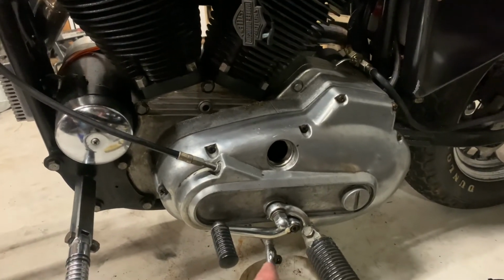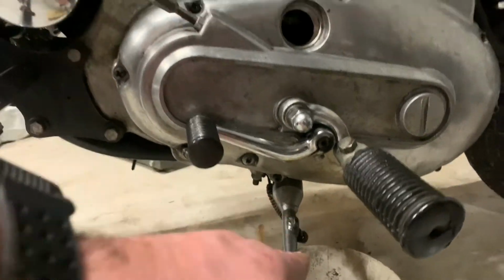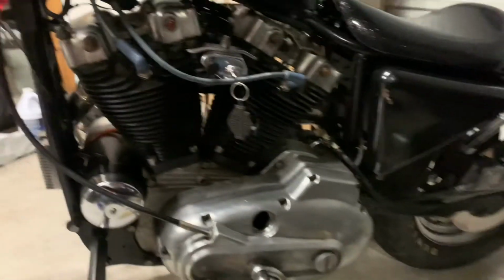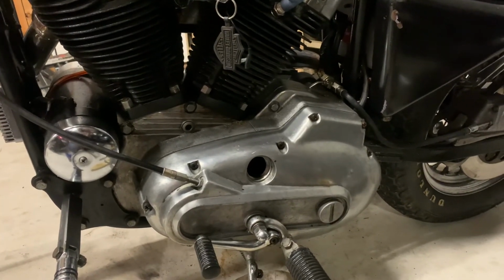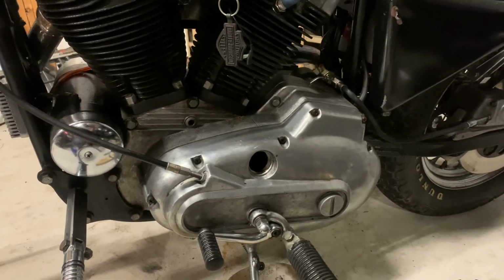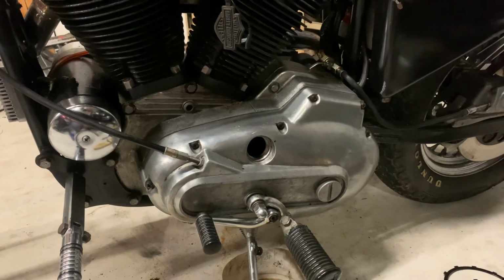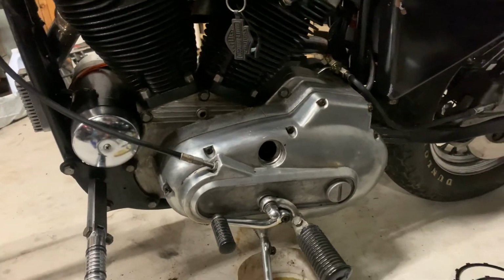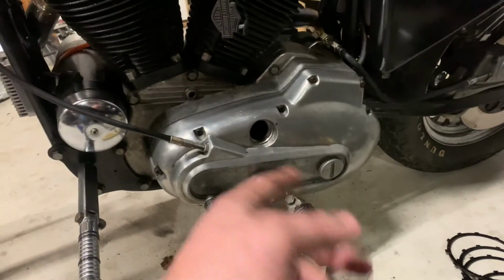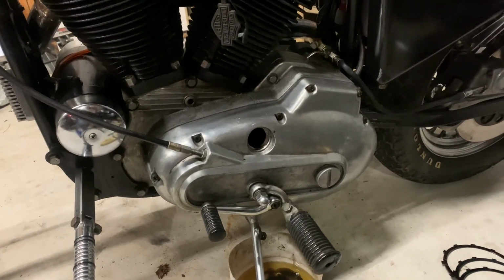And somebody's boogered up the fill plug. So you normally just take out that plug and fill it up there. And also somebody put an 8/0 front end on this thing, so it's not level. So the best thing to do, these things take 24 ounces. So I gotta say 28. I'm gonna do like 25, 26. And I just pour it out to the exact amount I needed in the quart in order to dip the other clutch plates and new ones in. And now I'm gonna fill it up for the rest of the quart. So it's pretty simple.